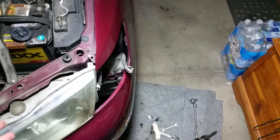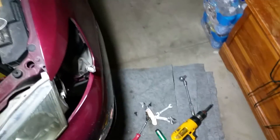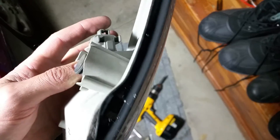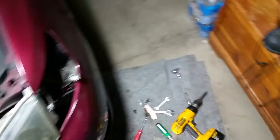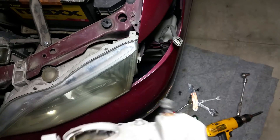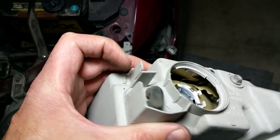You don't have to do anything with the actual headlight. Then you take the wire harness off — you just stick a screwdriver right there and pry it towards the top, and the wire harness will slide off. Once you do that, down in the hole you'll be able to see a 10-millimeter nut right there. I suggest you just loosen it and then undo it by hand so you don't drop it down into the hole with all the plastic shrouding.